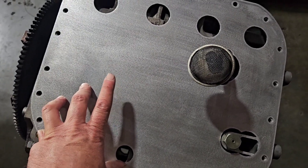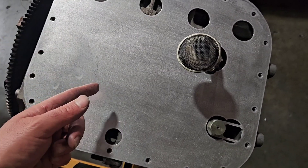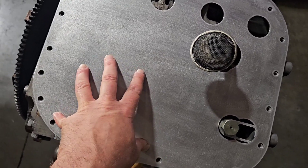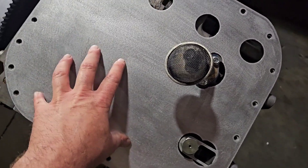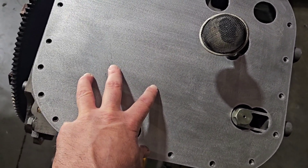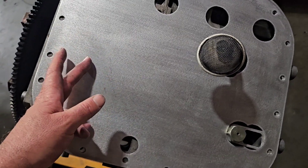For under a hundred dollars you can protect yourself from engine bearing failure. For your normal track day cars — if you're running FBs, FCs, general rotary engines with normal oil pans — I would almost consider this a must. This engine actually came in for bearing failure; I found a couple of issues with it, and it also didn't have a slosh plate or baffle plate. There wasn't any protection built in, and it had some reasons why it potentially wasn't making proper oil pressure in the first place. So we fixed those issues and added protection — this is a 12A motor, so we upgraded to the 17mm pump for a bit more volume, shimmed the front regulator, and upgraded the rear regulator. The whole package should now produce more pressure, more volume, and have a lot more protection from slosh.